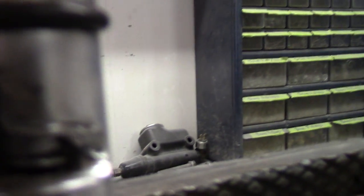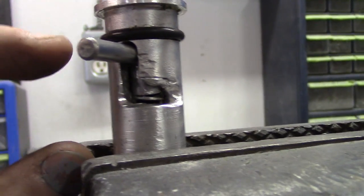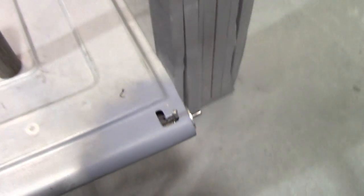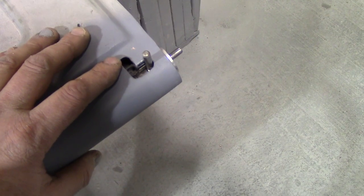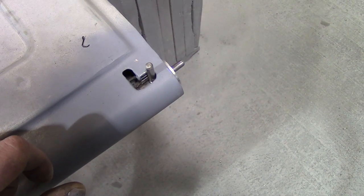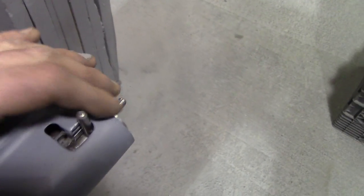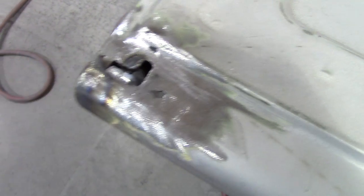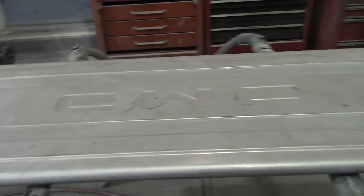Be very careful - you can just see a spring down in there. Don't cut in there and wreck the spring. And don't worry if your little notch isn't perfect - mine was done with a die grinder and it's not the greatest, but you'll never see it because this part slides into your tailgate. So you don't have to do a million-dollar job there. In the end, you can see I've already got this one locked. Open it - I cut the tailgate where I'm supposed to right there, then notched it down. And for you guys using these on Ford pickups that they're meant for, this would be a great little trick - notch these barrels so they lock down. Any guys who've used these know they're fairly tight. See, that just makes it so much easier for opening and closing the tailgate.